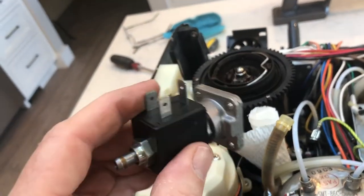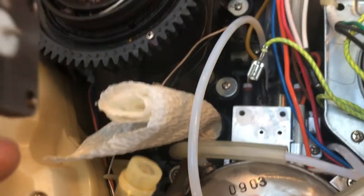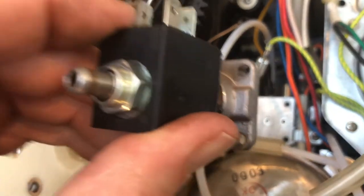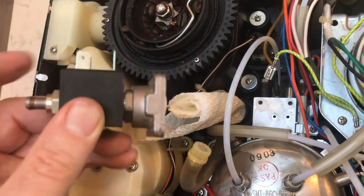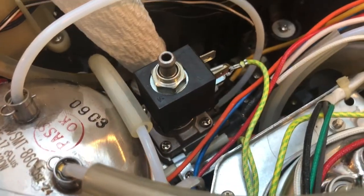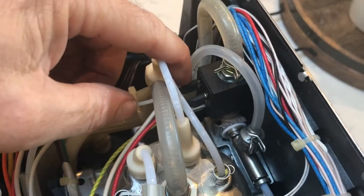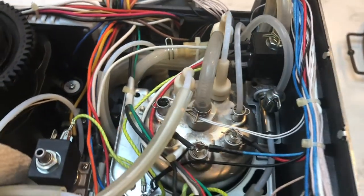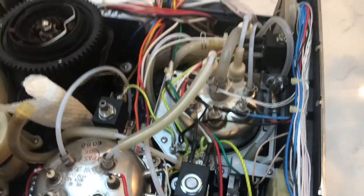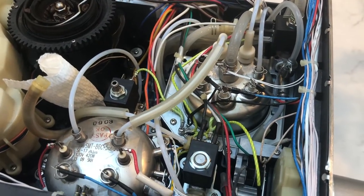Back in the machine. You've got to make sure these electrical connections and these two prongs — you can see they're on the right hand side — go back like this. Make sure it's aligned like that before you tighten the nut at the top. Screws are back in. You need to add the electrical connections and the pipe back. And there is actually one more solenoid valve over here which I haven't done — we need to do that one next as well. Not sure what that one does. Three all together — one, two, three. Beautifully made — they just need to be cleaned.